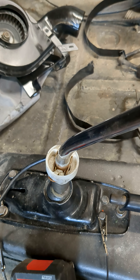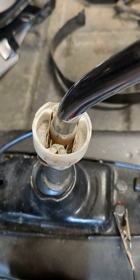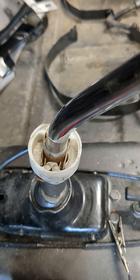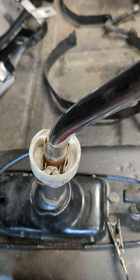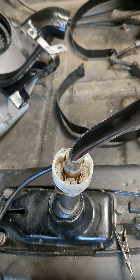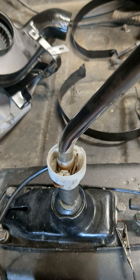Basically, as soon as you want to shift gears, the little contacts move and make connection. It activates one of the circuits in the valve in the back, pulls the big vacuum actuator on the transmission that's under the car, and releases the clutch. Then you shift up and shift out of gear.